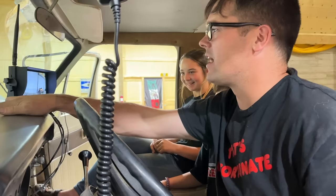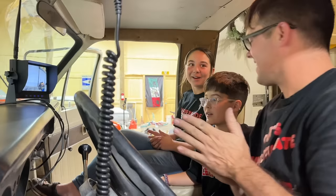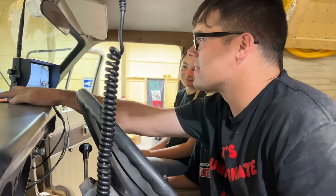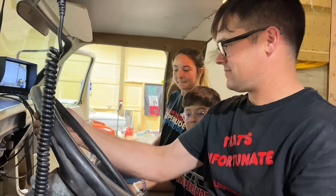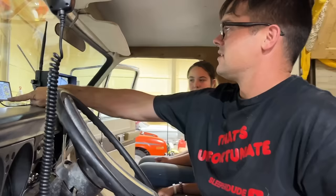Look, oil pressure is 75. 71. It's running a lot better. The battery's not charging. I forgot about the alternator. We never hooked that up. Look, it actually revs and goes. Look, you got reverse. Man, it's taking gear good now, isn't it? 71 pounds of oil pressure.